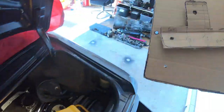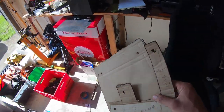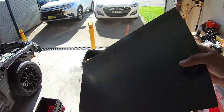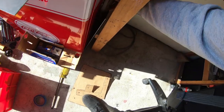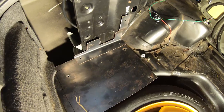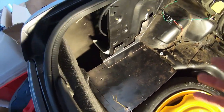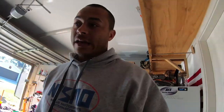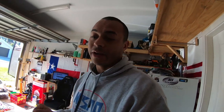I just drew these up, went out and bought a piece of sheet metal — I think it's like eighth inch thick — pretty sturdy. Traced my templates over it and then took it to a friend of mine over at RB Powerhouse Fabrication. He went and cut them all out, put the bends in how I needed. That's the plate and that's the bracket — how everything sits. I've got the bolts right there. I just bolt that into the existing holes one, two, three, then I bolt the crate to the bracket itself, and that's basically the battery holder slash tie-down part done.